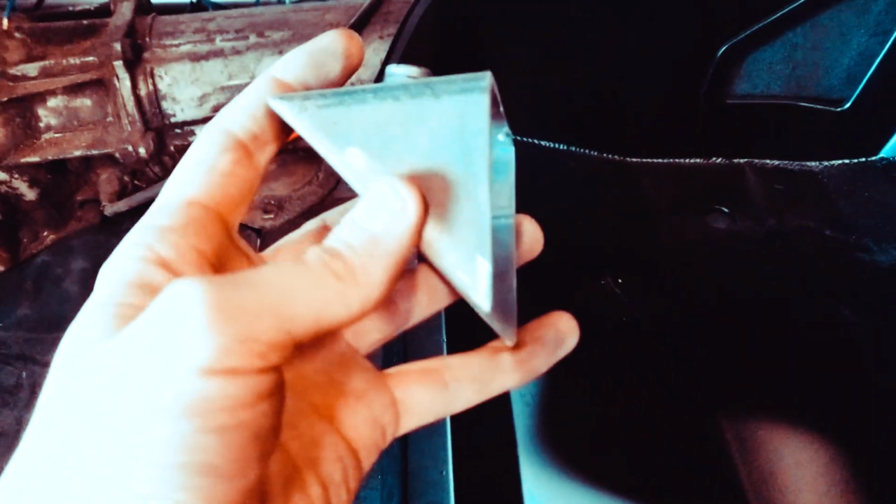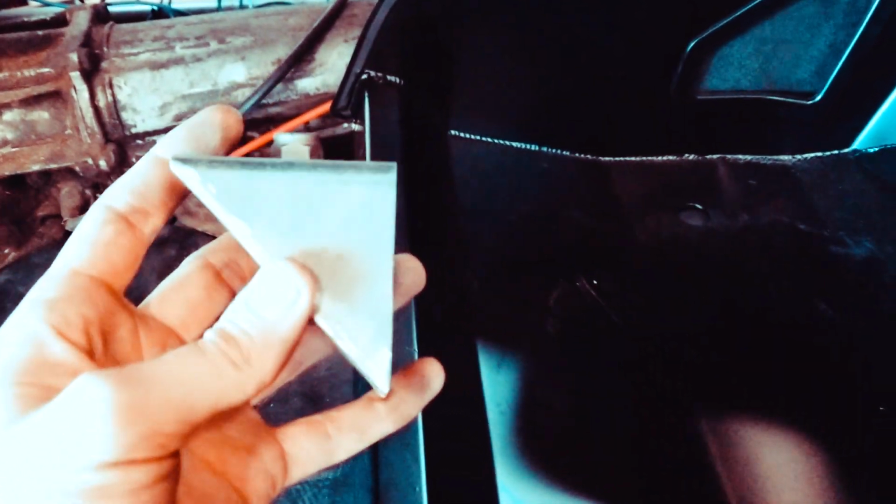As soon as these are set up, I'm going to have it in place this way it doesn't move. So basically these pieces here are gonna get welded to the floor. This piece is removable, so it'll come out, but these will stay attached to it because they'll be welded to it. So I'm gonna do that, get these tacked in, bolted into the seat, and then once I know it's not gonna move and that's gonna be the place, then I'll do these ones and the seat should be mounted. Pretty simple. But that's the idea. It's just gonna be super simple. I can get to my bolts, everything like that. I am gonna cover the seat with some material, probably some like memory foam or something.